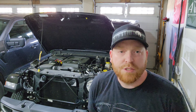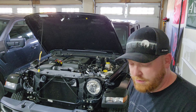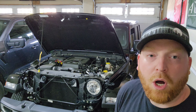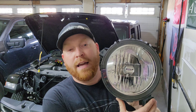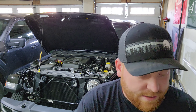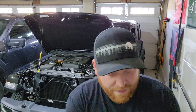Hello and welcome to another episode of Bolts and Boost. As you can see, the front end of my brand new Sahara Unlimited Jeep Wrangler is torn apart. It's quite easy to tear the front grille off — there are six or seven little plastic clips you just pop off with a pry tool, and then some clips you pop out at the bottom. What brings us here today is I'm replacing these dismal halogen lights in a $70,000 Jeep — due to COVID supply chain issues — with some proper LEDs. These I'd be happy if my wife made it home on a winter's night when it gets dark at 4:30 and she has to drive across the city.